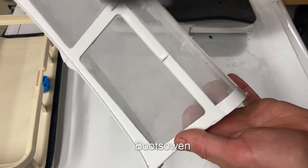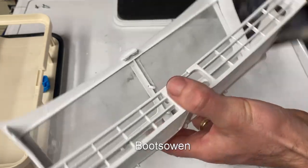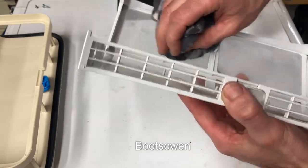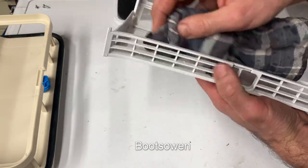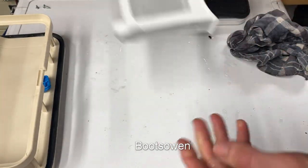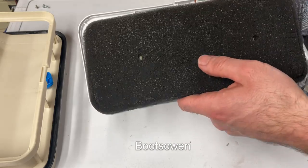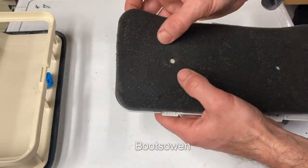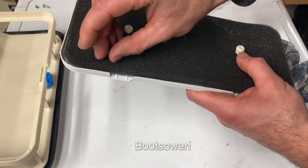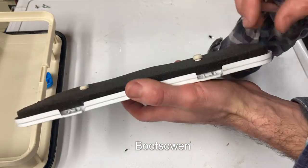I'm just going to give it a bit of a wipe to take any excess moisture off the outside and any extra lint that I can see. It doesn't matter if this is wet going back in, because it'll dry pretty quickly, or it'll keep getting damp from the laundry, depending on what phase of the cycle we're in. It's clear that these hadn't been cleaned in quite some time, so it's a good idea to do it more often — I would recommend after every drying cycle. Put it the right way around — I'll put it around the same way as it was before. Any little specks of fluff or hair need to be removed, so just look over it carefully and make sure that it's clean.